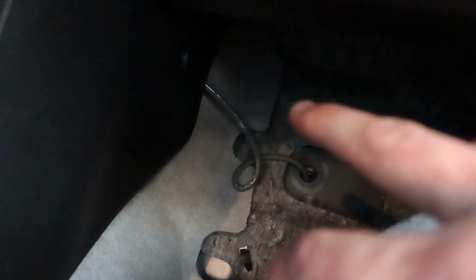That's good right here. Alright, with the carpet removed, we're going to roll this foam. This might snap, but it's going to be toward the bottom of your car, so you'll be able to hide that. And there's our grommet area right there. You can see there's the stock sensor, so we're just going to follow suit with that. I'll show you guys to the best of my ability. But there you go, you can pull that, move that to the side, and there's the hole taking you to the bottom of the car. That's exactly what we wanted to see. Oh, there it goes, through the hole.